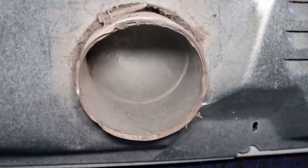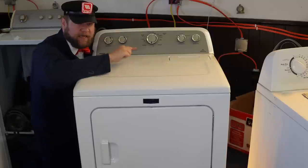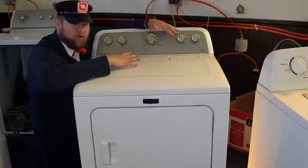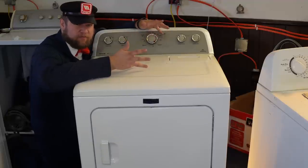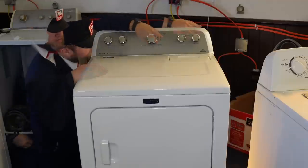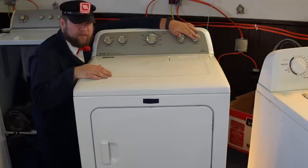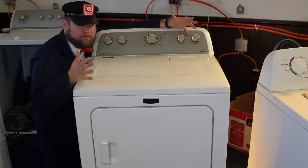Let's look at the vent pipes, usually at the bottom of the dryers. The left and right ones from the rear are amazingly clean, but the middle one absolutely does not — you can see remnants of wet lint at the bottom of the pipe along with some rust. We've had multiple red flags on this dryer, so let's try it out. I suspect this one is either going to not heat or not going to start. Make sure that any dryer you turn, if it's an old-style mechanical, you always go clockwise — the gearing does not like going counter-clockwise. Yep, something's wrong with it. 95% chance it's going to be vent restriction. The white thermal fuse is bad — great flip for me, but bad for a consumer.